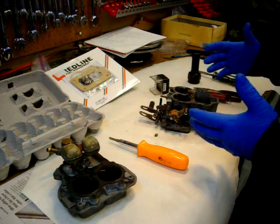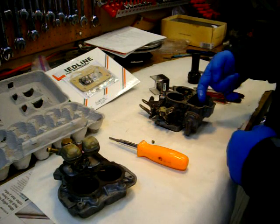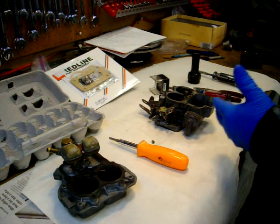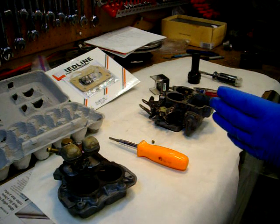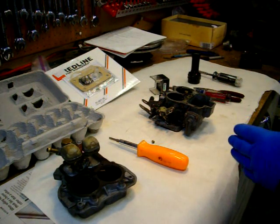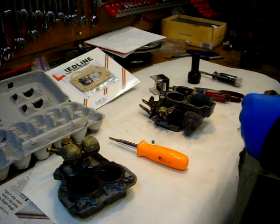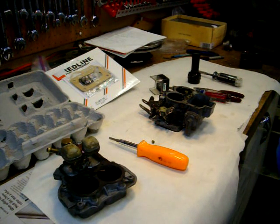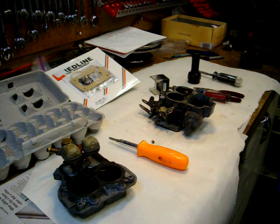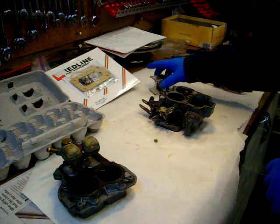This is clear, but since I've already turned it upside down and dumped it out, there are floaters in there — so there could have been some crap that floated down in front of that jet. I had to pull the choke to get it to run decent off idle, so it wasn't getting enough gas. That tells me not much gas is getting into the circuit.